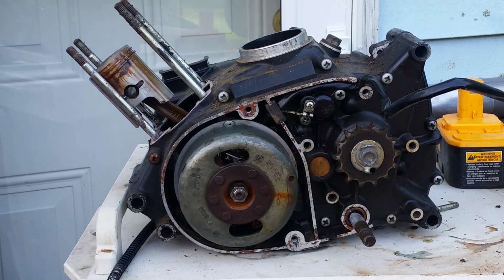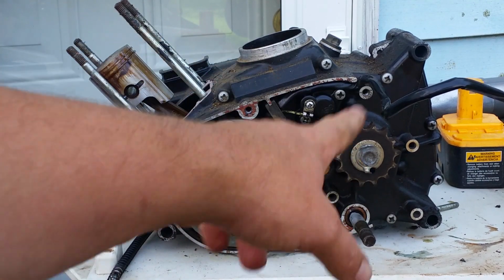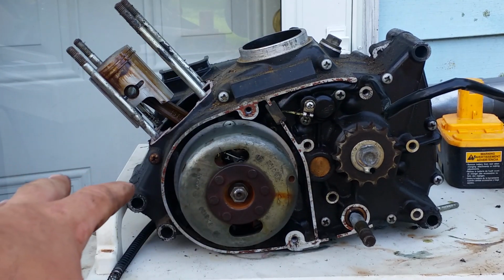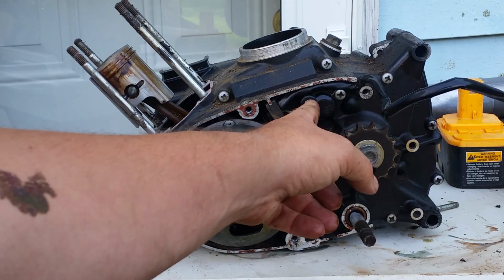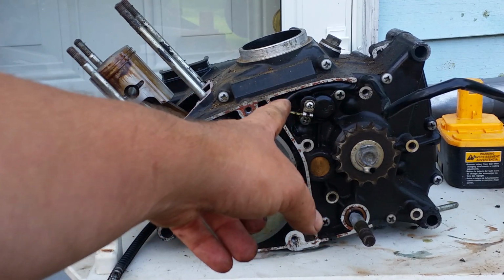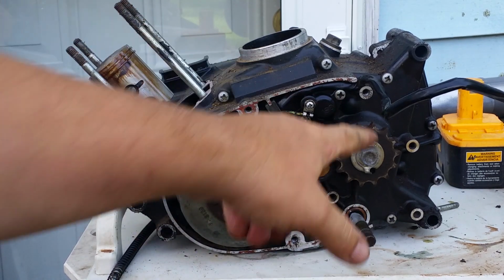You just got to keep your old motor for some parts, because you're going to need to replace your neutral safety switch, which is a direct changeover bolt-on, and everything's the same. Like that little plug right there that you plug that green wire into on your KE100 is in the exact same position and will bolt on. It's interchangeable 100%, no modifications. So when you're in neutral, your green light comes on your dash. That's what that does right there.